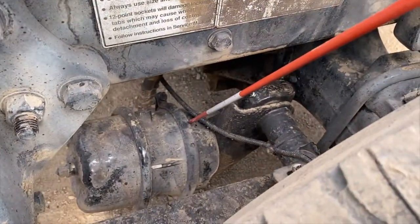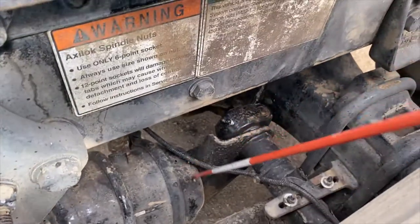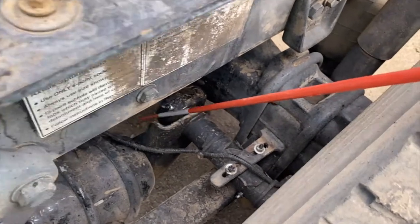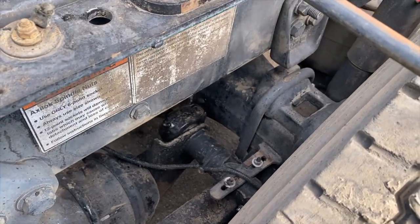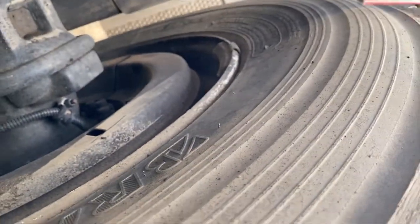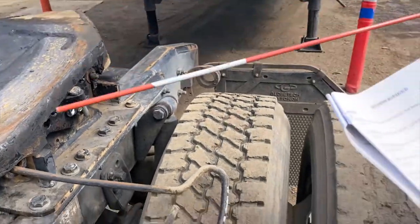On Section B, unlike the front, in the back you have a push rod and slack adjuster — you can see them right here. So that gives you five brake items: brake hose, brake chamber, push rod, slack adjuster, and brake drum.